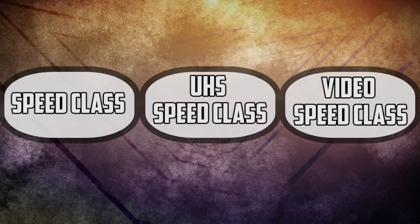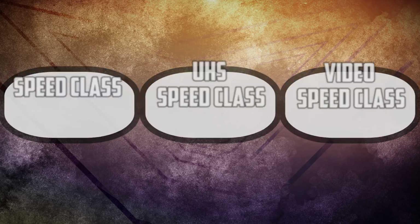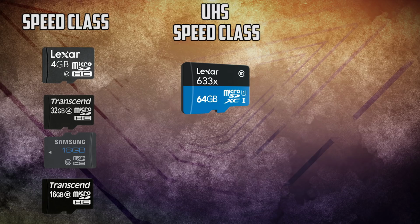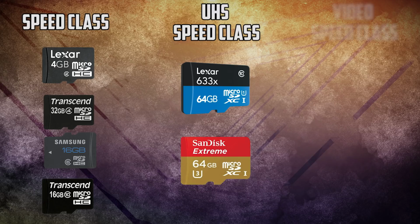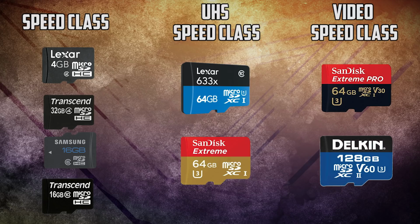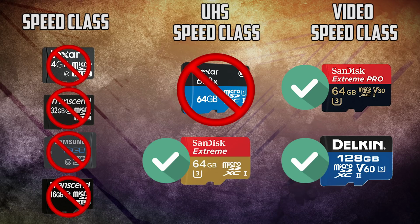There are three kinds of video speed classifications: speed class, UHS speed class and video speed class. Speed class is designated as class 2, 4, 6 and 10. And UHS speed class is designated as UHS speed class 1 or UHS speed class 3. Video speed class is designated as V10, V30, V60 and V90. This indicates the minimum sustained write speed necessary for video recording, so that a minimum and constant speed is guaranteed for camcorders and cameras. A higher class rated card supports high bit rates of video and higher quality video recording.